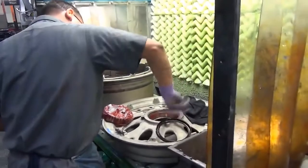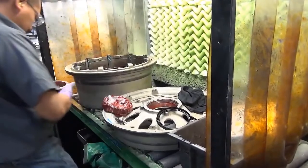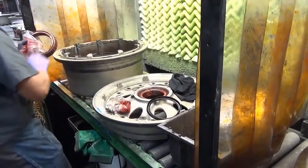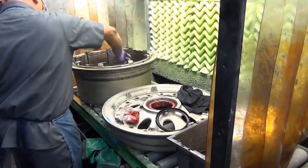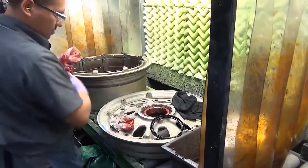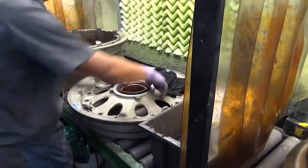Apply a thin film fully covering the exposed bearing cup with the same type of grease used on the cone and rollers. Intermix of different types of wheel bearing grease is not permitted in the same wheel bearing assembly. The grease used to lubricate the wheel bearings, grease seals, and bearing cup surfaces must all be the same. In addition, any grease used to lubricate axle sleeves or axle sleeve lands must be the same as the bearing grease used to lubricate the wheel bearings.